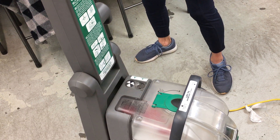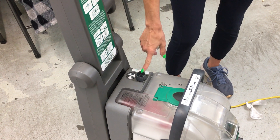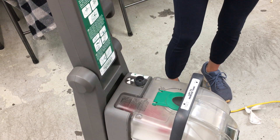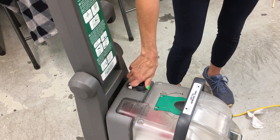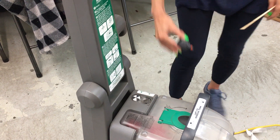If you have a hose, you can test it by plugging your hose in. This is just the end of your hose — it does not come off of yours. If it does, your hose is broken. You can put it in here, turn it on. If it sprays out the hose but not out the bottom, more than likely you have got a frozen solenoid valve.